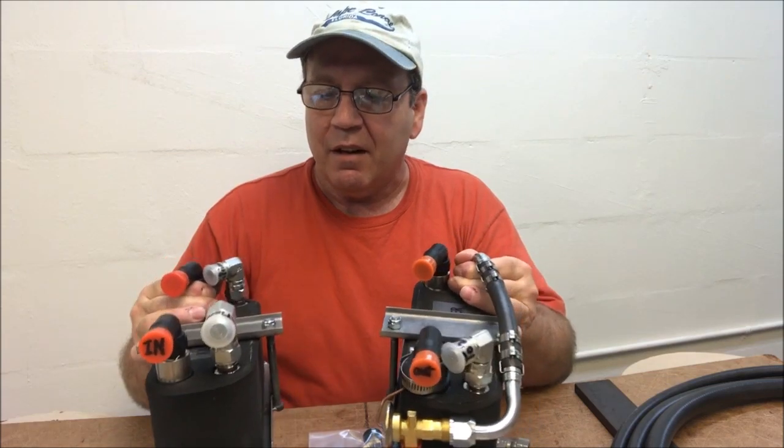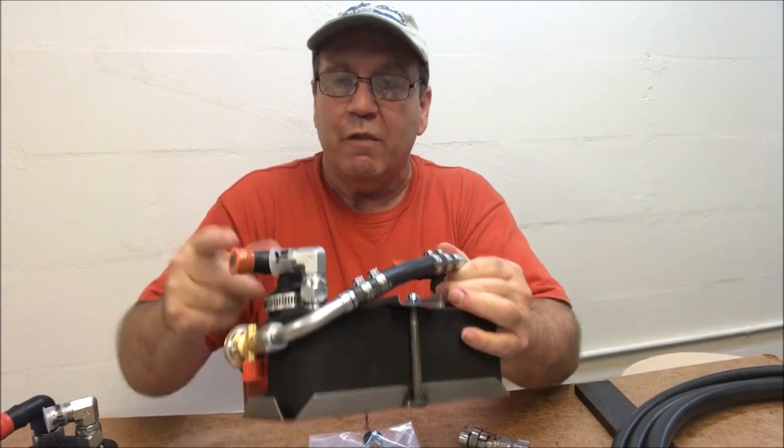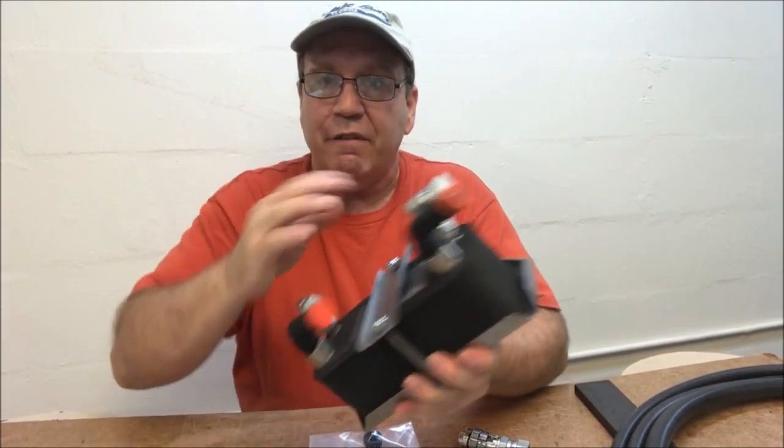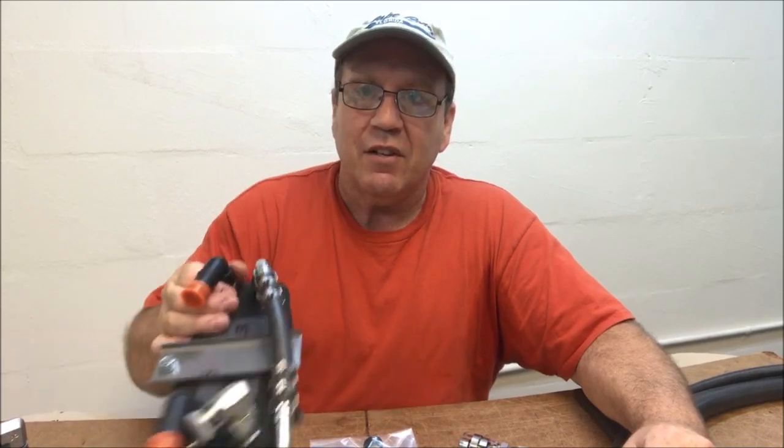It really wasn't that much more of a cost, and I saw a huge benefit just to have this in the car. The way these things work, they work in tandem. Your intercooler fluid will flow through this one, and then once that fluid has been cooled, it will then flow through the second one. Probably drop the intercooler fluid another 20 degrees after it passes through both KC systems.